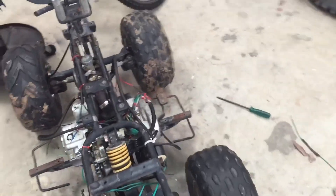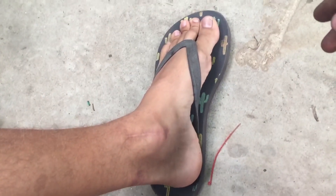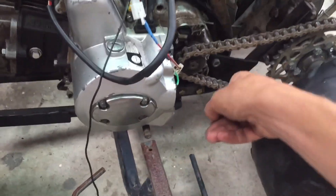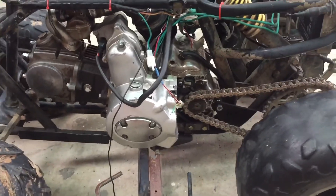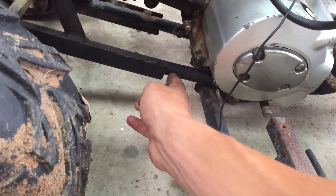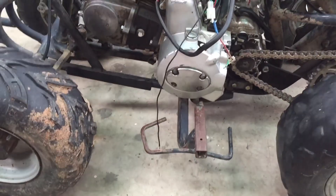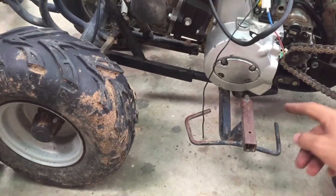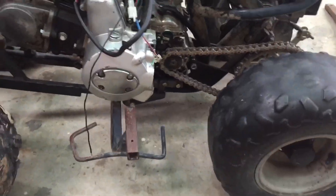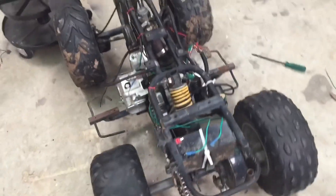I'll put a switch in there later, but last year I had a major problem with this — I put it back together and I broke my ankle. It went underneath there and the sprocket grabbed it and ripped around, did it really good. So hopefully I don't want to do that again. I'm going to cut the frame down here and up here and lengthen it so that you can fit your foot in between the wheels. Then I'll just bend the foot pegs forwards a bit so it's still in the middle of the wheels, and put a bar to the back chassis so that you can't get your foot stuck in the wheel.